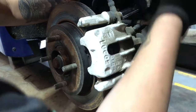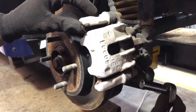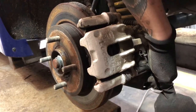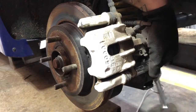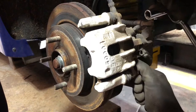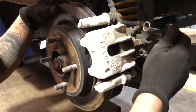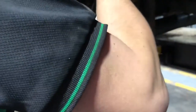The top one was a bit hard but as I went along it was relatively easy enough. The bottom ones should be the same. These are quite small bolts and they've got loctite already on the thread, which was handy. Now I should clarify — what I was removing first were actually the caliper bolts, not the carrier bolts. There's another bolt right in front which is a long slider bolt, and those do come out. We'll move on to the actual carrier bolts in a minute — both sets are very tight, so make sure you do them up really tightly when reassembling.